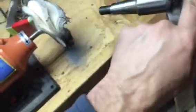I'm at the 180 right now and I've got all the grooves out of it. There's no more grooves in that journal — it's smooth now. So now it's just a matter of going with the 240 and then I'm going to polish it and it'll be like chrome.